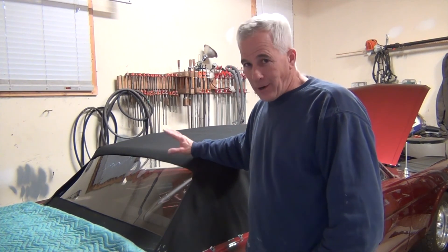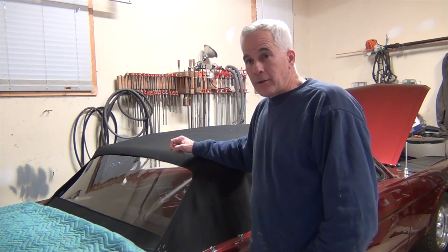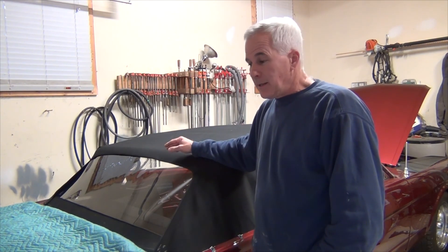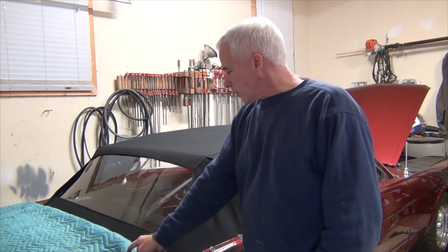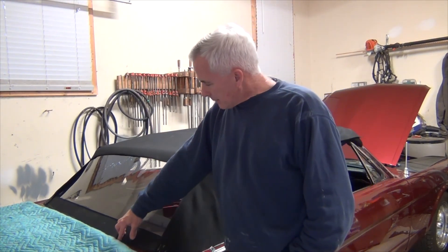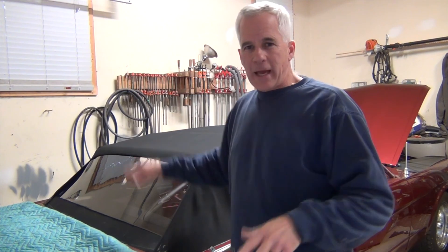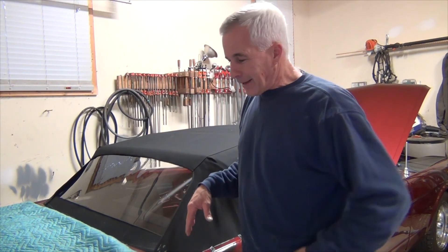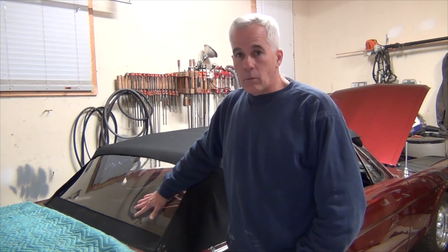I took this curtain in and out of the car like 15 or 20 times. When you see videos or read something about doing this that says you have to be patient, you do. And I am not a patient person, but you just have to be. There were a couple times where I was convinced I was going to have to order a new one — I got it on the tack strip nice and pretty, cut the notches for the bolts, even trimmed off the excess because I knew it was going to be perfect, and then it was a complete disaster. But this thing is very, very stretchy when you heat it up.